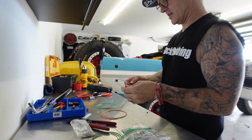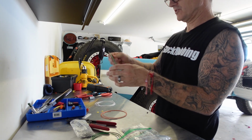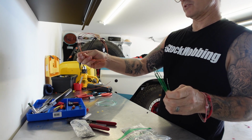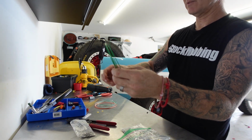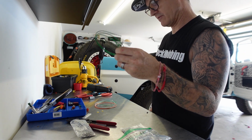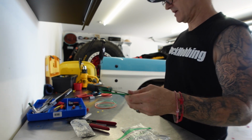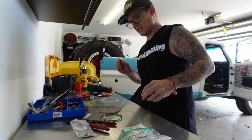So this is the signal. This is the ground, sensor ground. Actually, this is the sensor ground. This is the sensor 5 volt, and then this is the tach. So I'm going to have to do some experimentation with the tach. It wasn't working, but I think we've got it going in the wrong place. It says to go off, if you have the MSD, use the MSD, not the coil. Or it could be something I have in the software that's set up wrong.